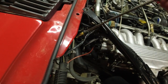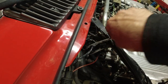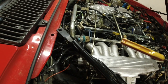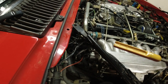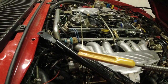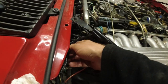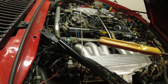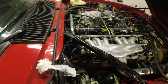I'm just going to work it through the gears now a little bit. Before when it was cold, it would make a little bit of noise in reverse. Let me go through them all. Should have pumped fluid through all of it now. Let's go out and see what the level is. I wiped off the dipstick and we're checking on the cold side. We are on the minimum — somewhere between about half a liter between minimum and maximum — so let's add about half a liter and see what it looks like. We're just above the maximum on cold and starting to get close to the minimum on the hot side.